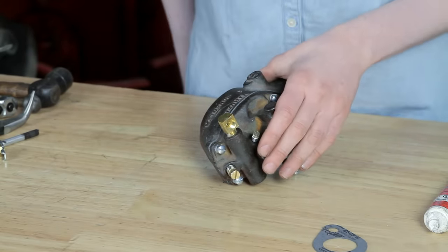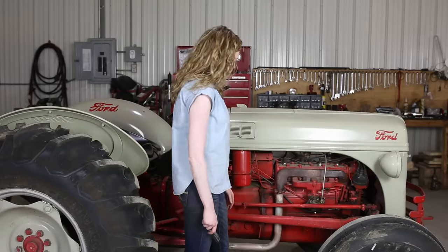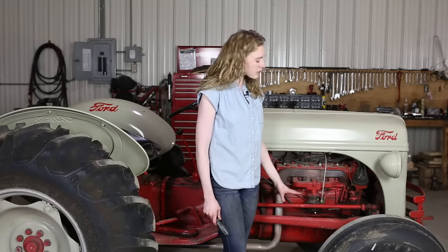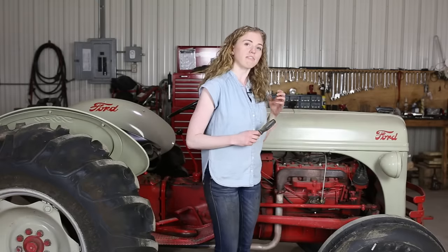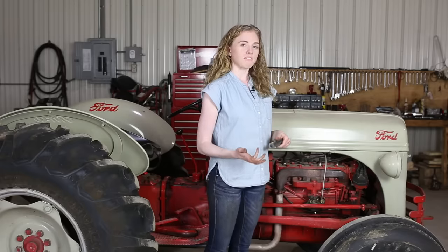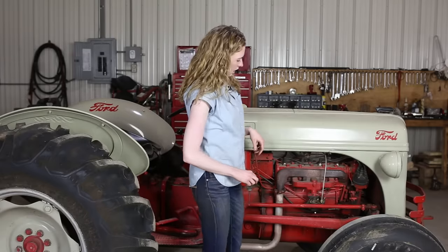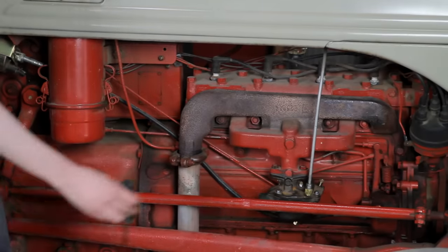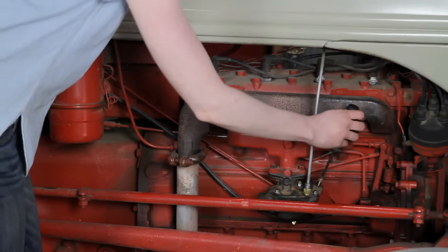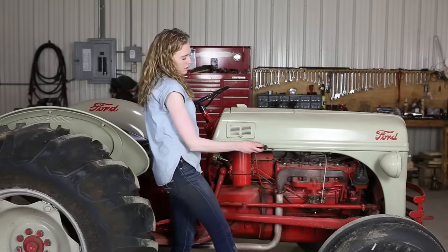My carburetor is onto the tractor. I made sure all the remains of my old gasket were removed before putting it back with a new gasket in place. I don't have my tube on yet because I want to make sure the carburetor doesn't leak. I'm going to start it up and make some fine tune adjustments — first I'll test it on an idle, and if it needs an idle adjustment I'll do that on this screw to take the flutter out. Then I'll rev it up to make sure it revs well. My tractor is in neutral and it's safe to start. The idle sounds good — let me rev it up. I'm going to turn that out just a little bit more. That seems to have a better throttle response.